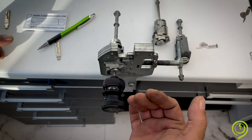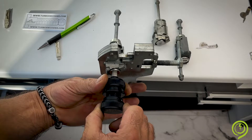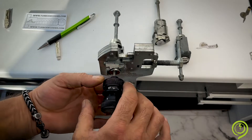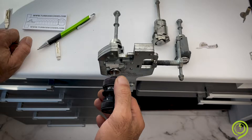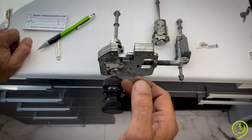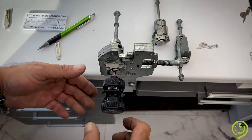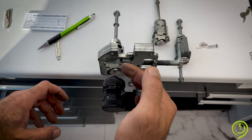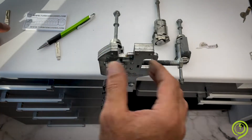If we need to extract the mechanical code, we have to do this: keep in rotation, maximum pump here on the back wheel, and juggle the tool by following the plane of the profile. Go on the other side and juggle again. Go to neutral and check — go to left, easy and smooth; to right, easy and smooth — exactly as the key does. The code of the lock is now very well imprinted on our sliding pins. To extract, turn right, push to the front — only now you can extract. If you forget to close this and push it to the front and leave it, you will destroy the tool. If you are locked but not right on the back wheel, you will also break the pins or the tool. So please: front, right, extract.